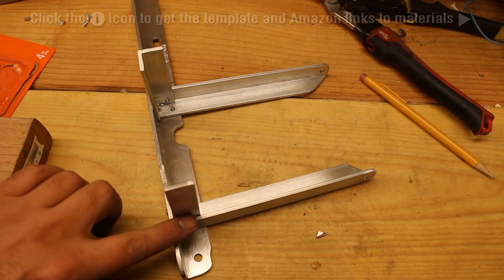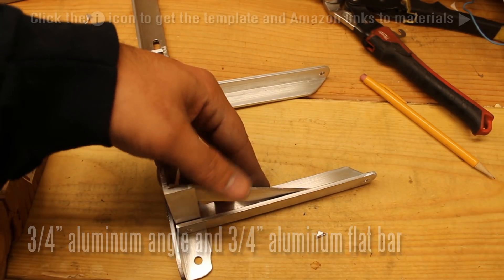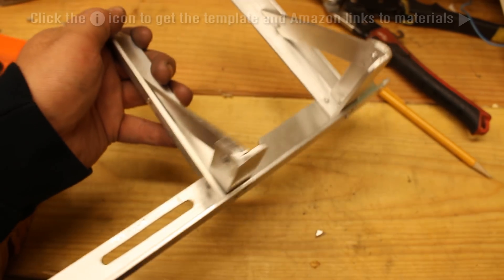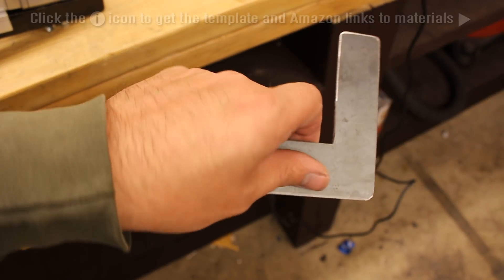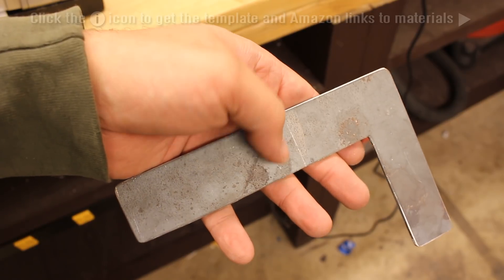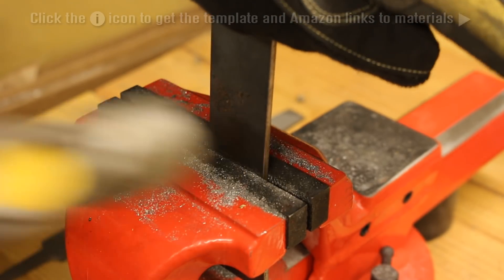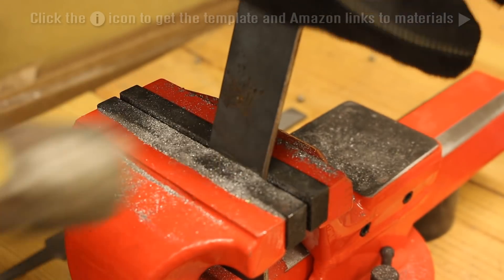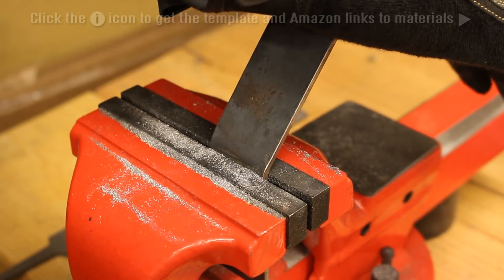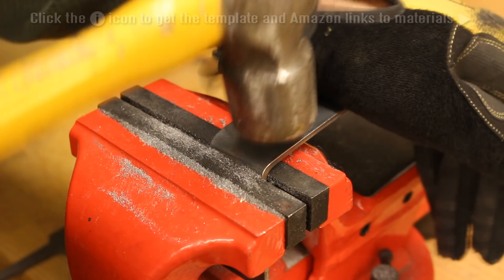Works well. I've got these little risers — this thing is upside down, by the way — and I'm putting in some angled brackets to make sure it's nice and strong. This is what the plate will rest on when retracted, and it also helps to hold it secure when it's extended. This piece is made out of steel for strength. This will become the bracket for the linear actuator to bolt to the rest of the mechanism. I've got little score marks and I'm going to put it in a vise and bend them over.